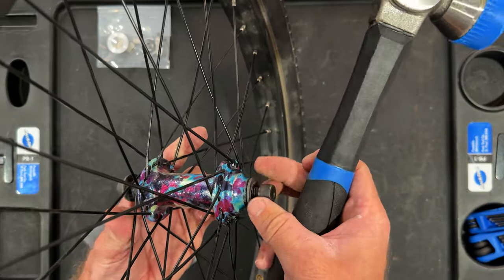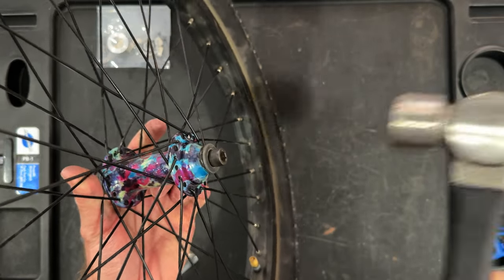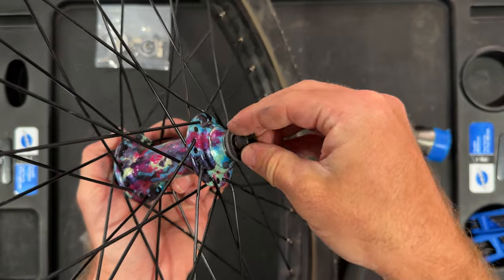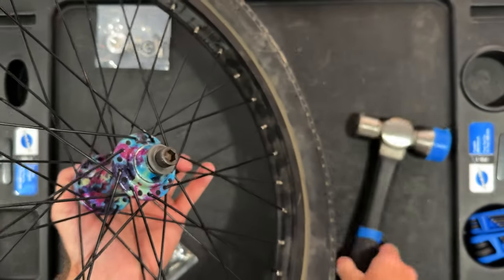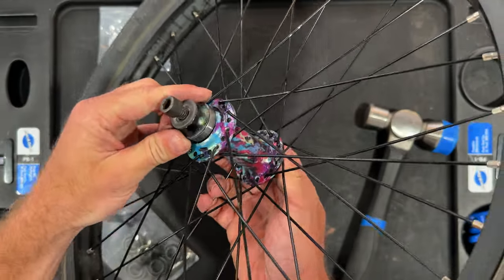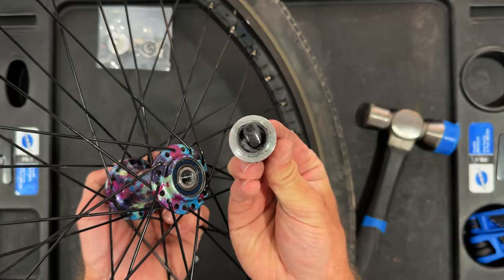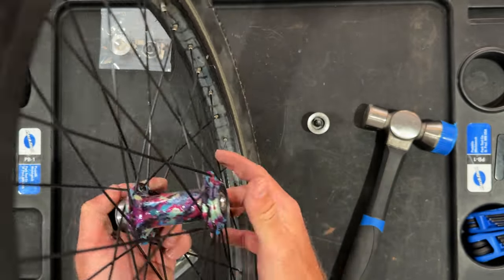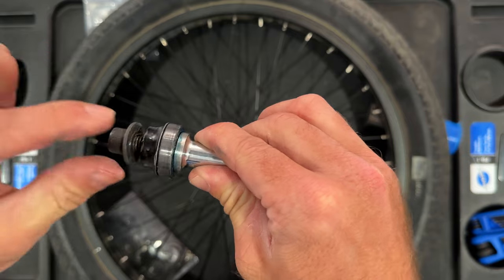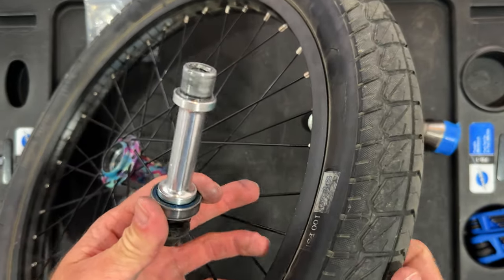It's very straightforward — we just take a hammer and hammer on the axle, and as you can see it's pushing the bearing out of the other side. We loosen just a little bit more to get that bearing all the way out. The bearing is now loose. All we have to do to take the axle out is remove the axle bolt from this side — our cone spacer comes with it and the axle comes out. This side came off very easily but the other bearing and cone spacer are pretty stuck.